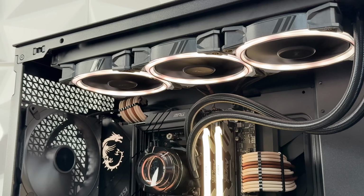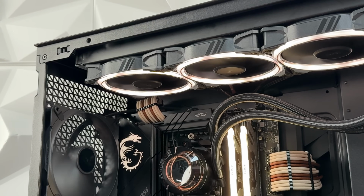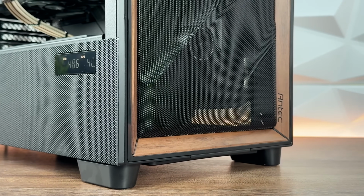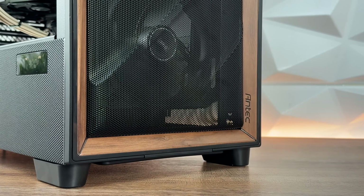Now in fifth position, there's also one possibility: 420 millimeter radiator with fans up to 70 millimeters, and the front can go up to 360 push-pull with maximum thickness of 60 millimeters plus 30 millimeters. So the fans would be placed on the front ones that create a push combination.